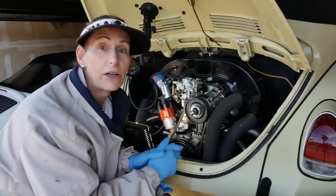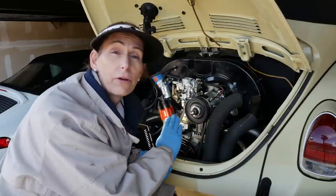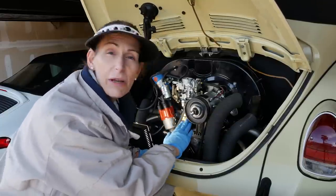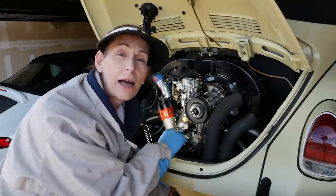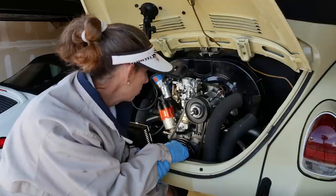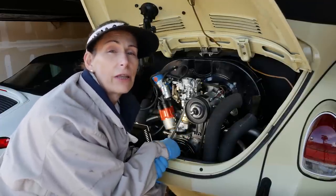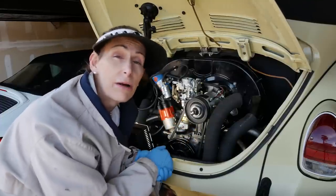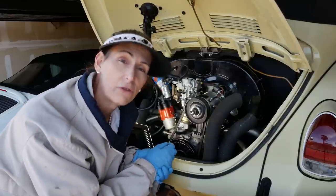I mean, that's a great question, right? I believe that was the correct procedure for an original Volkswagen pump. But these pumps must have, I'm guessing, a stiffer diaphragm in them, and they can maintain a higher pressure. I've done a bunch of research on this and tried to figure out what to do. If you're going to use one of these aftermarket pumps, I think your only solution really is to add a pressure regulator.